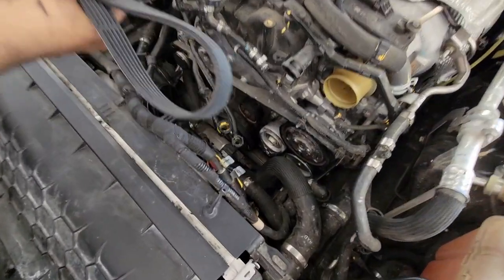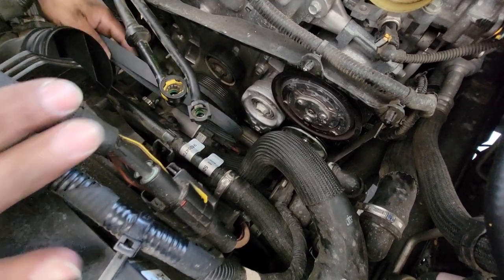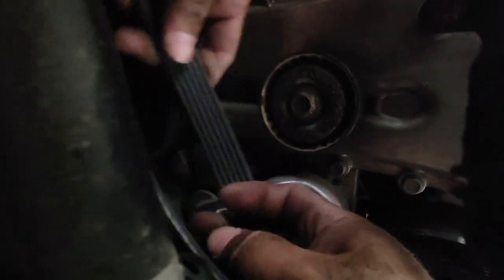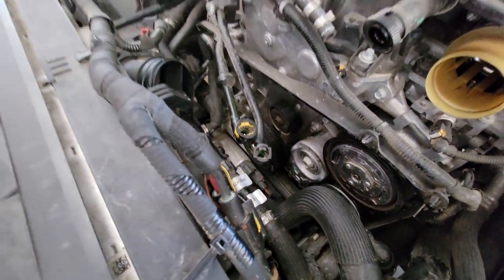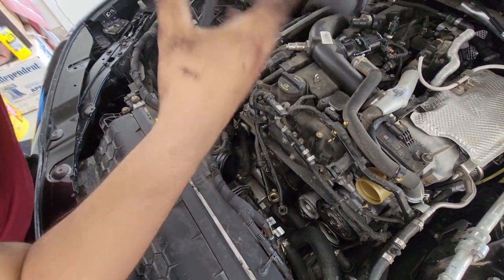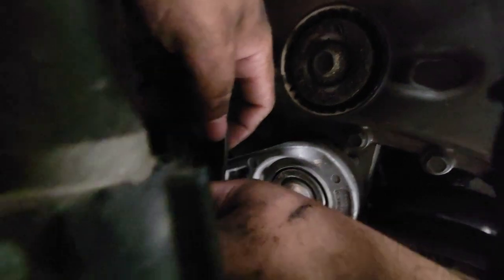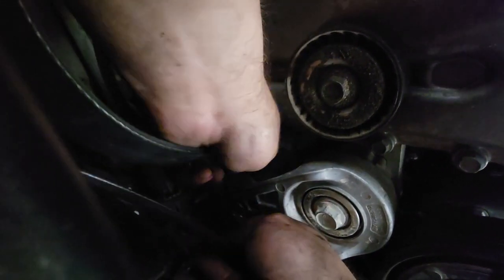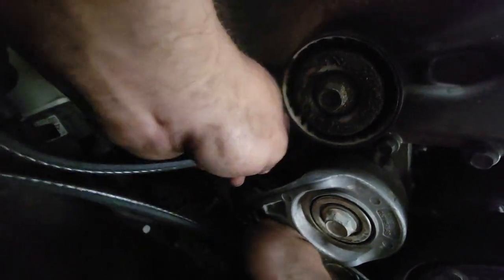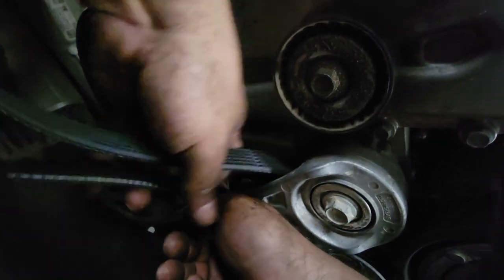So, put it back in. It's going to be a little bit confusing, but it's not that hard. No slack on the right side — right now you want all the belt this way. You're going to want to come in with the teeth facing the engine base. You could take it out and twist your belt while you're at it, so all the teeth are out. It's a new belt, it's going to struggle a little bit, but it'll be fine. Teeth facing towards the engine.